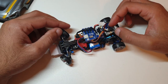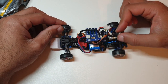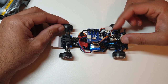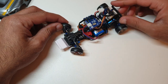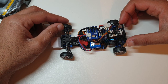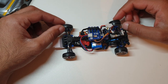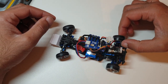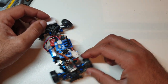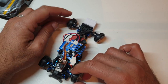Once you've got the hang of that and the feel of it, the next thing you'll want to do is try and see if you can provoke the car into coming in and out of that slide. To get the car to suddenly engage into a drift, you'll find you'll have to blip the throttle — put a bit more power on to lose grip at the back — and that'll make you slip. You'll see me doing that in some corners where I want to bring the back end around more. If you're going slow enough in a gentle enough drift, you can change direction just with the steering and the car will follow.